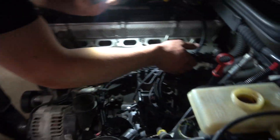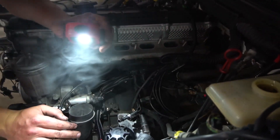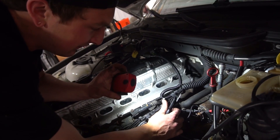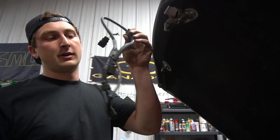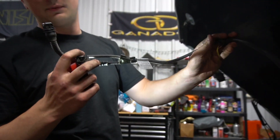The only thing that's killing me is I can't find the most important plug — the cam sensor or the crank sensor. I think there's a short somewhere. I wonder if that's a crank sensor. There was a sub-harness that we forgot about, so this actually plugs into the crank sensor and then this plugs into other things. Who would have thought?